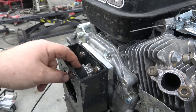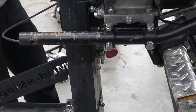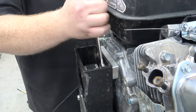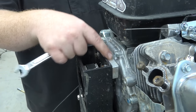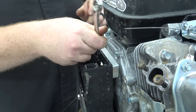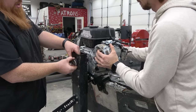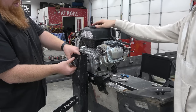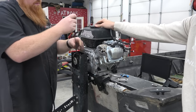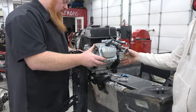Look at the belt riding all the way against there — I probably mounted it in the water and didn't get it seated right. That's going to wear that belt quicker. Loosen the tensioner down there. I'd assume we can take these off; when we put it back together, we'll slide the engine up, bolt this first, then tighten, then do the bottom bolts. Watch the washer — it dropped down inside. Pull the engine back. We'll run a zip tie to keep the pulley from falling.